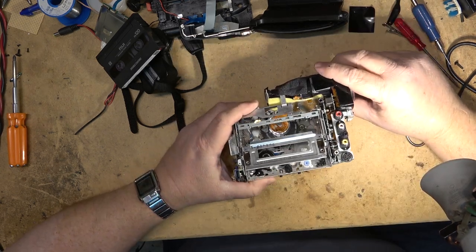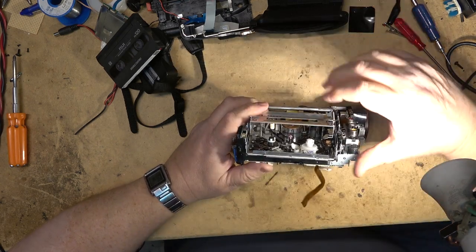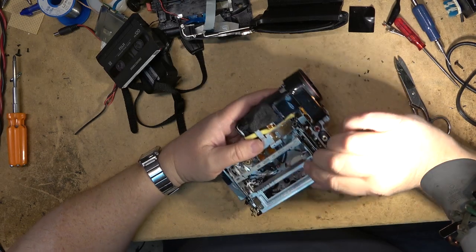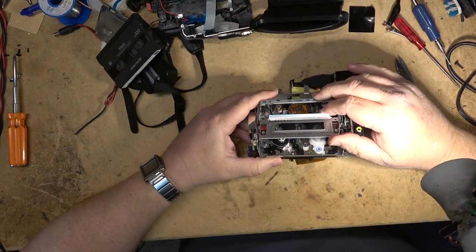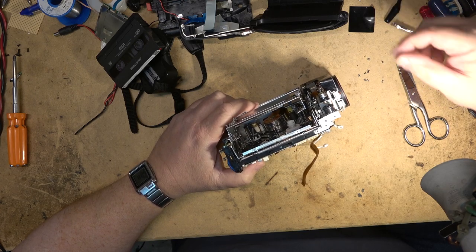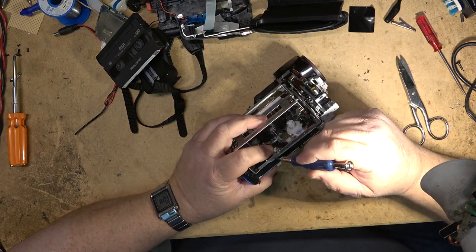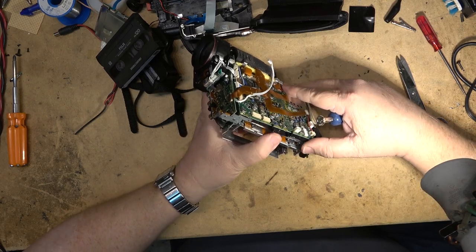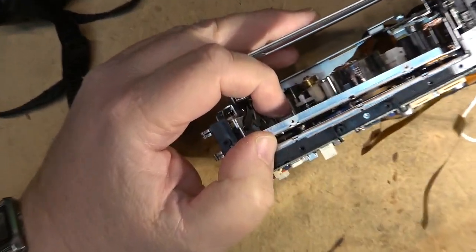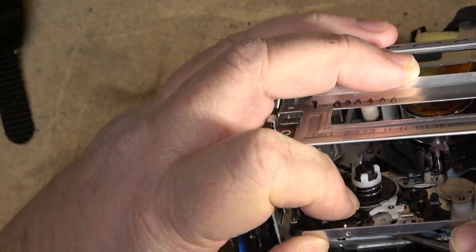I think this camera is probably a total loss. It appears that it's bent over here — you can see how the chassis is bowed down. My suspicion is that when someone loaded the tape, either they pushed it in wrong or a plastic piece in the loading mechanism broke, and it got bent trying to get the tape out. I did find a screw lodged in the mechanism, and now there are pieces falling out — this mechanism is shot. This metal piece is coming out.